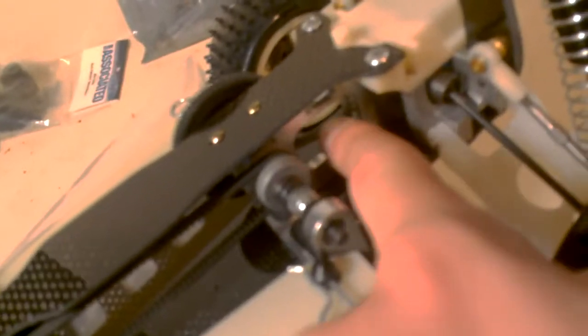The difference between this and the Suzuki motor mount is that the Suzuki mount is a 3-piece. You have one piece for the motor plate, then one piece for this bit here, and then another piece to brace these two plates together. This is a 2-piece unit, so this bit here and the brace is part of one L-shaped piece, and that screws against the plate with 2 screws on the other side. There's also no cap here. This is an enclosed hole. So when you mount the center lay shaft, you actually have to take this unit apart, mount the lay shaft, then put the motor mount together, and then put it on the chassis.